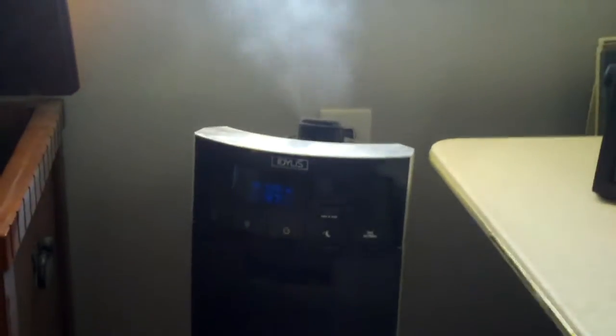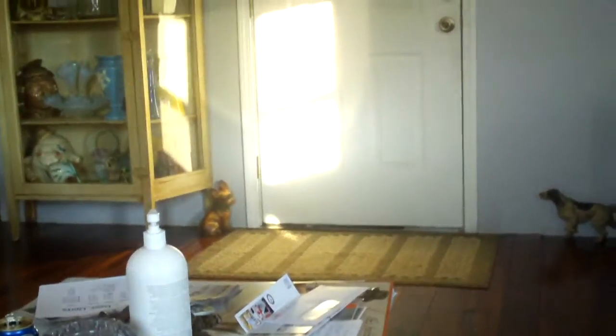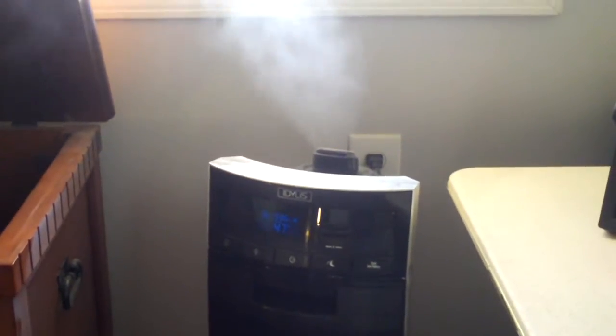So it's always important to have a humidifier in the environment you're fixing computers in. Because when you raise the humidity to almost 50% or something like that, the chances of frying a component drop significantly. And just to give you an example — when I walk around this house, I rarely ever get shocked when I touch doorknobs. The humidity here always stayed at a half-decent level, and with this humidifier it helps even more.